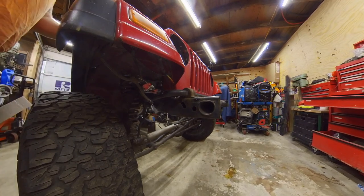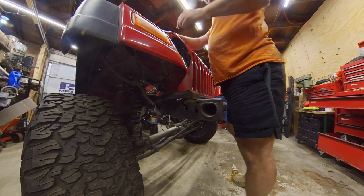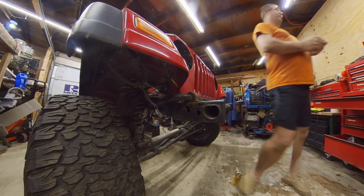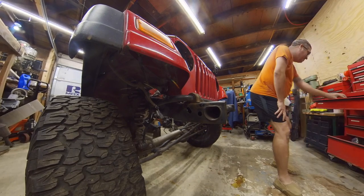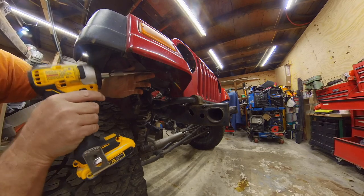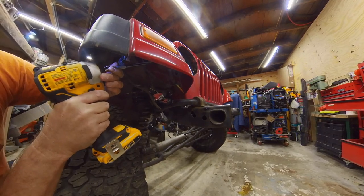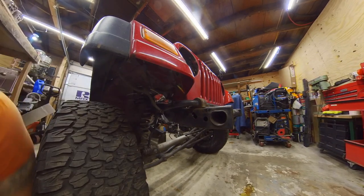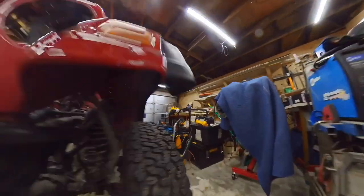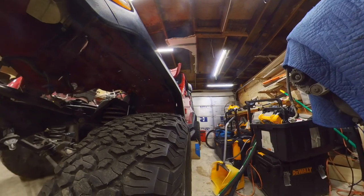These are not half inch. I bet these are metric. They are just acting really weird. I'll bet they are 13 millimeter, just based on the way it's acting. So let's try a 13 millimeter six-sided socket. Yeah, like to have not seen that move, but it is what it is. And what do you bet this side moves even more? Because there's some shenanigans over here.